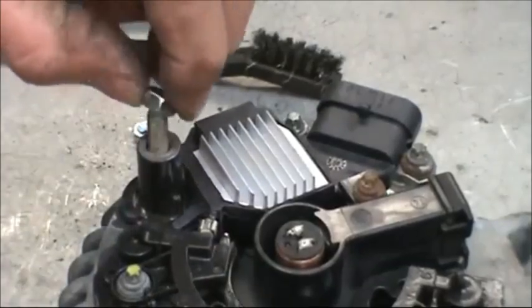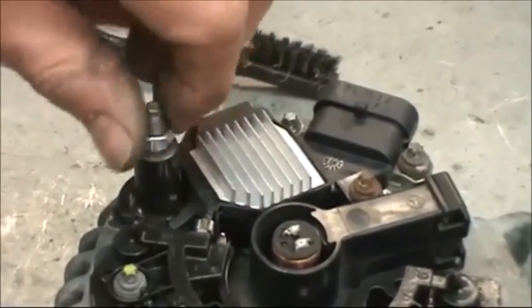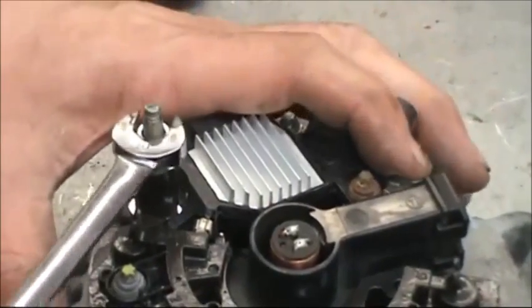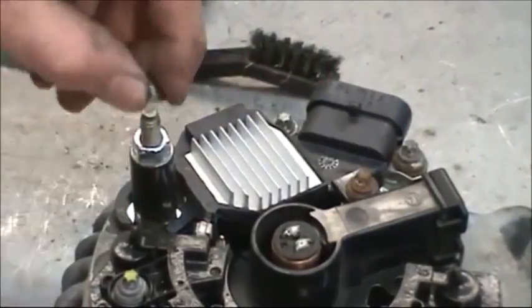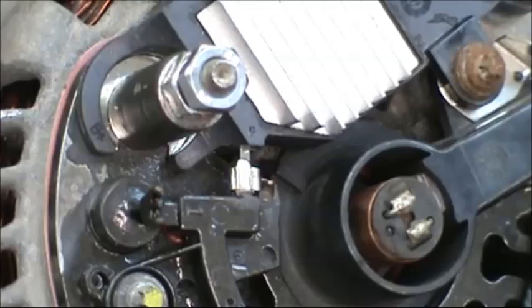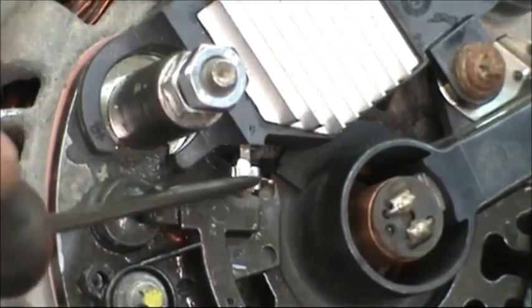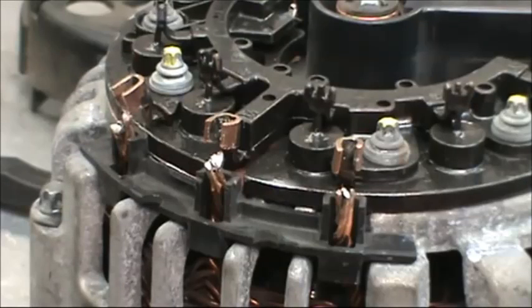One important step to this voltage regulator conversion is there has to be pressure on that ferrule to make contact so that it goes into the regulator for a feed. So you always install a bottom nut and torque it down, then put your battery connection on, and then use that as a retaining nut. Now we have 4 areas that need soldered. This one right here is pretty much self-explanatory. Solders up real easy.